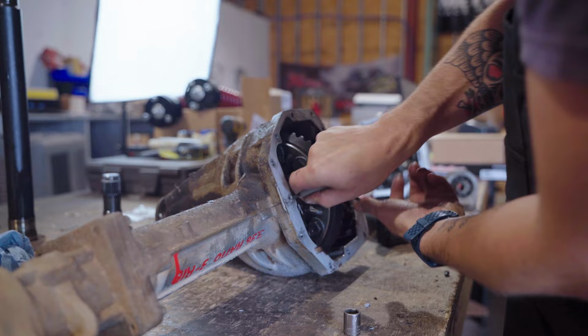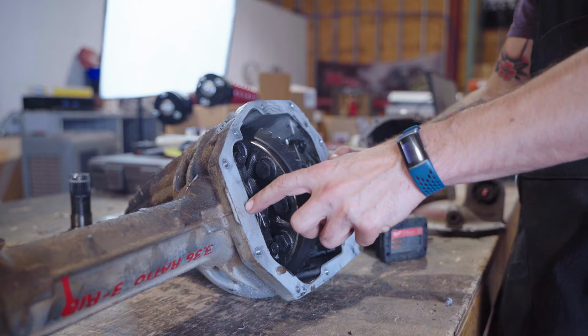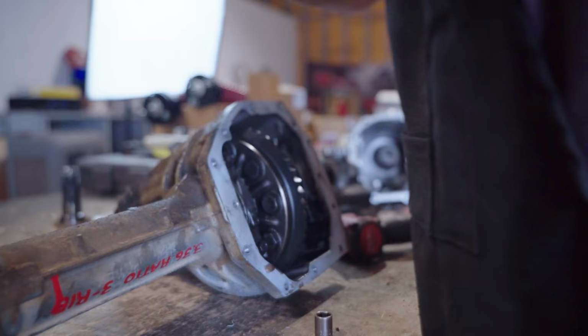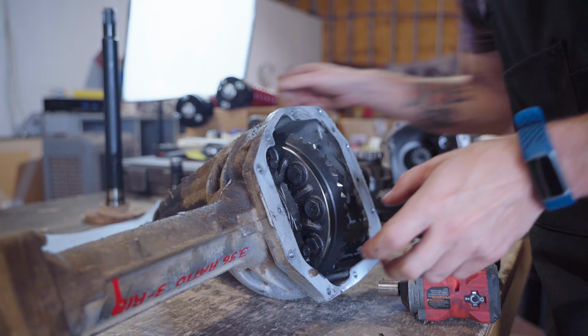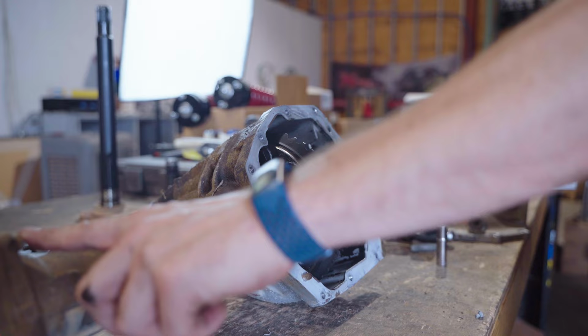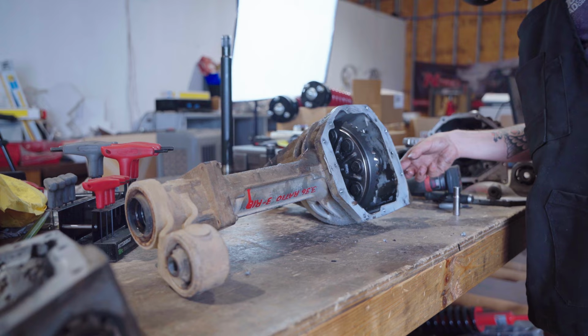Our TV is in the way. All right, so your lock screws on your threaded adjusters are backed off. Now you can pull your caps. Let me grab, I like to keep everything semi-organized so that it all goes back in the same place. Oh man, that stinks. But all right, so now you should have your threaded adjusters exposed. It might be easier to take this piece of your housing off. There's like an inverted hex on this side, and then this side is just a gigantic hex over here.